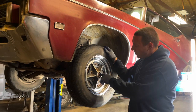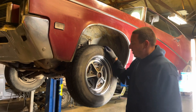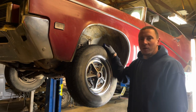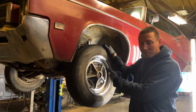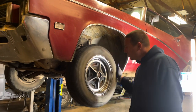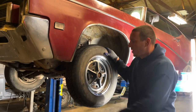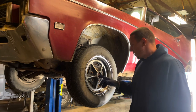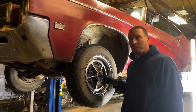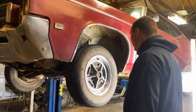Especially with these hubs that are attached to the brake drums. You don't have to pull all that off just to flip a spring over or turn an adjuster around or something dumb like that. But you can't hardly push the car, it's just dragging so bad. So we'll zip that off and pull the cotter pin, pull the bearings out, start on replacing these brakes.